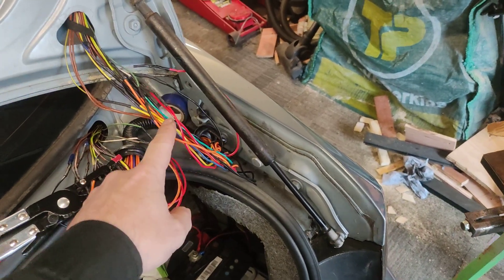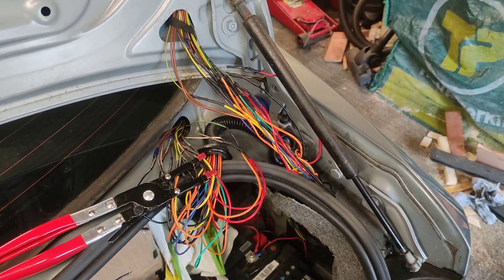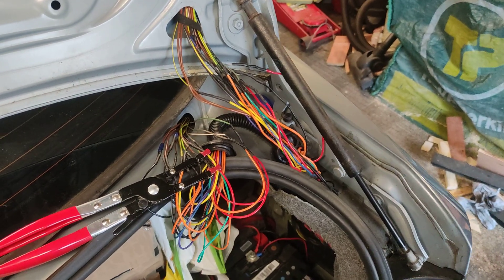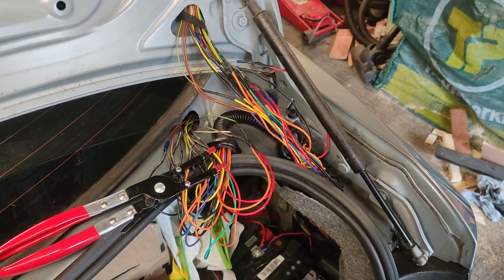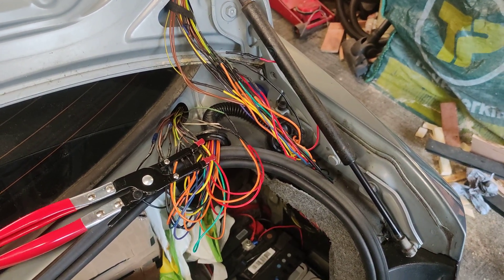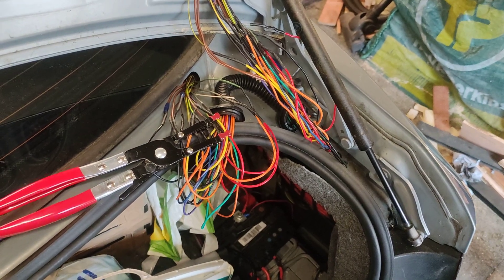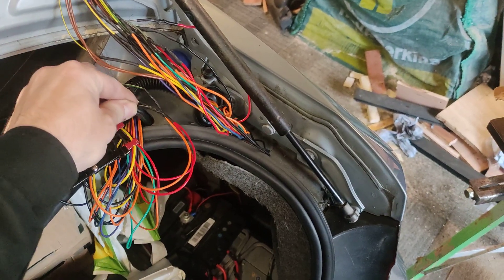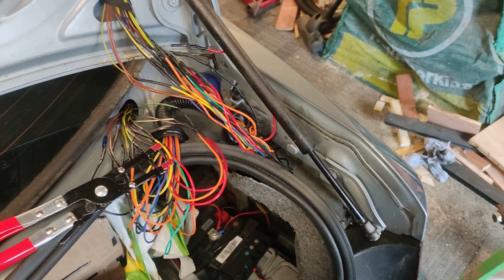As for the wires, all mine came from an old PC power supply. I used the 20-to-24-pin cable that goes to the motherboard — the main motherboard cable. It was longer than I needed and the wires were thicker than what the repair loom had. The repair looms cost about 60 quid — you can buy them from BMW as well, but I wouldn't recommend it. Just buy the grommet, and if you can find an old PC power supply you'll need about 18 wires.